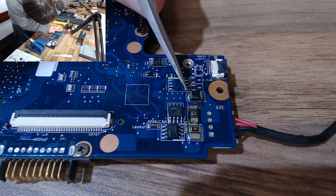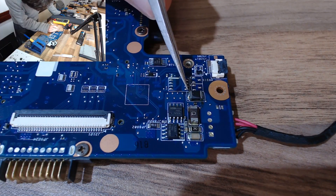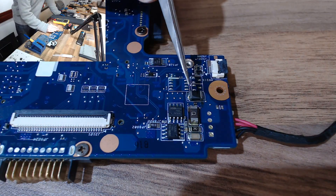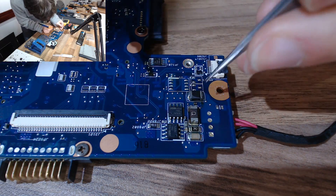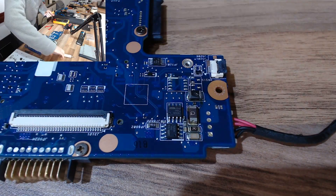I'm just going to touch up the end of that again because you can see despite having the flux and the soldering on the end, it's really struggling to make a good contact there. I think we've just had a dry joint on the back of this coil and I think that's the problem with this laptop. Hopefully if I can just get a really good solid solder connection there, that will solve this one properly. Let's just get some more flux on that.